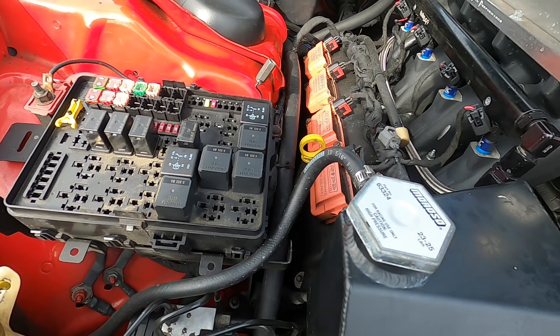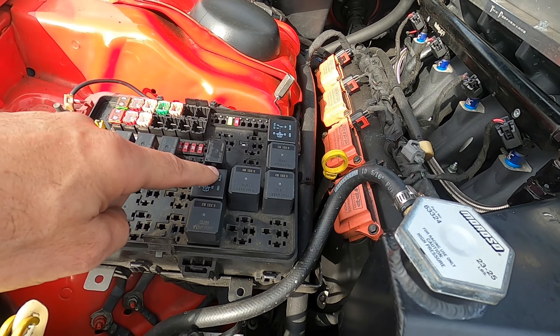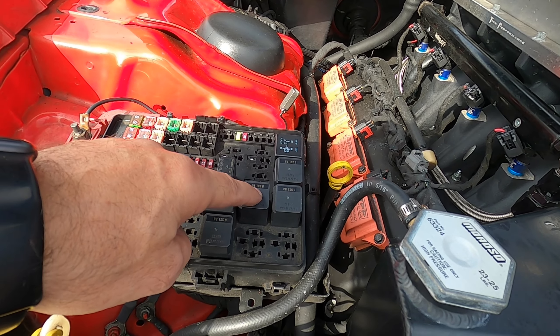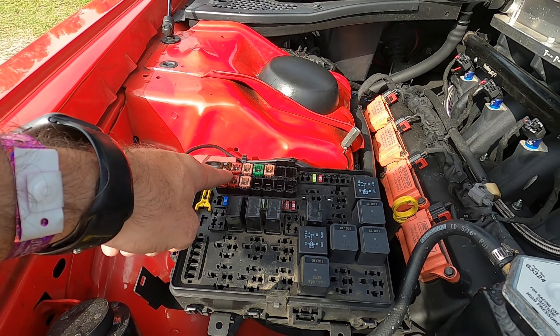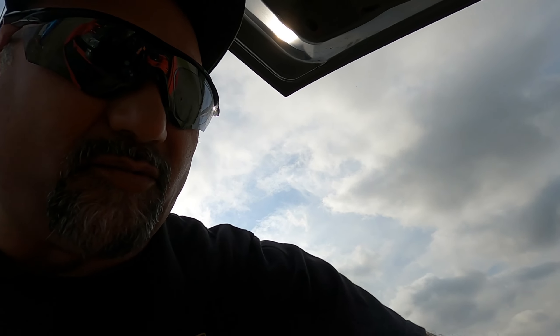The first thing I did, because I thought it was the fans, was pop off here. I left the same one in — fan relay. The 40 and the 50 amp for the fans, so I replaced those as well. Lo and behold, that didn't work.